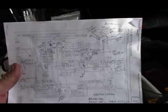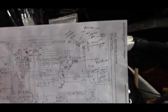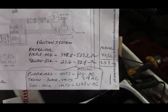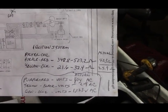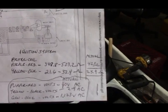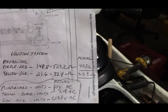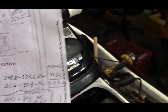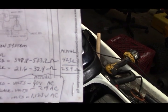This is the actual electrical diagram for this unit — it's too small to read on camera, so I made all the readings here from the shop manual. On the exciter coil there's a purple/red and a yellow/black which have to have tests. They're supposed to be between 348.8 and 523.2 ohms for the purple/red, and 21.6 to 32.4 for the yellow/black. The actual readings I got were 423 — so that's within range — and 25.9, which is also within range.